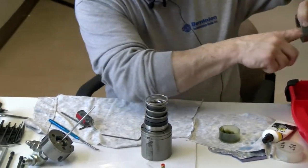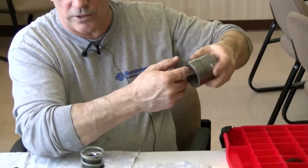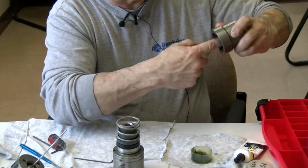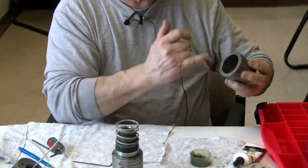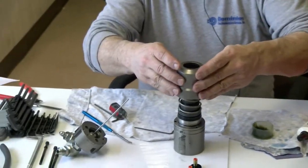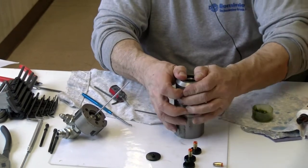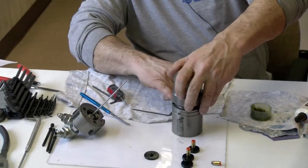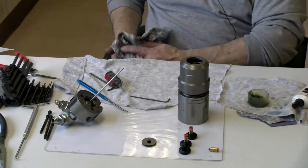On the whole wall, you can feel a little recess in here. That's probably as far as that seal will ride within. And I just lubricate it up to there. Wipe the excess off of the edges. And I set it on. Now, I do it all the way to the end because it's going to seal on the one seal down at the bottom. Now I just made sure everything slid on nice and smooth.